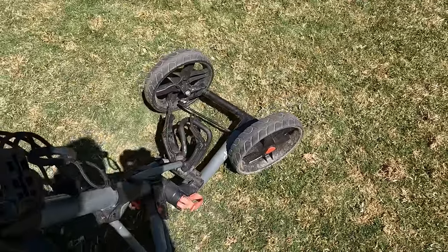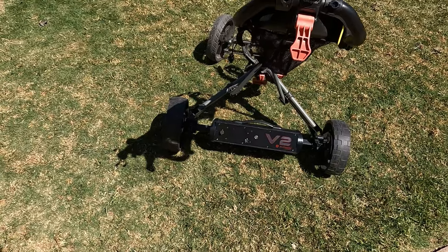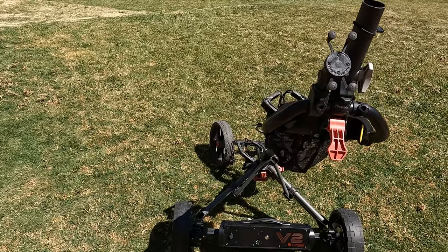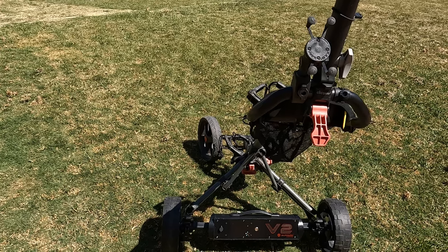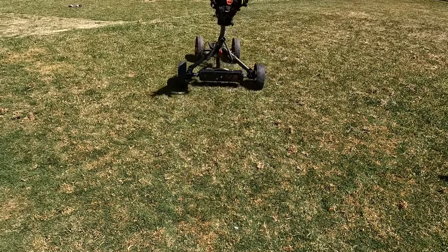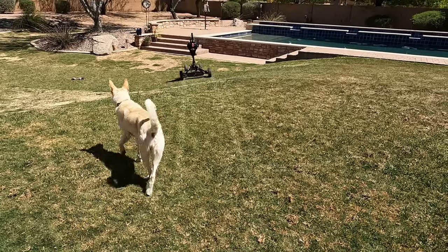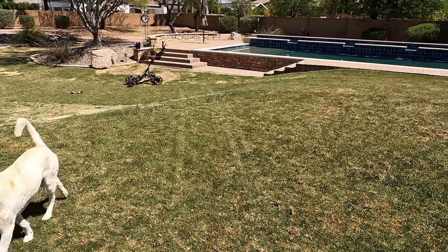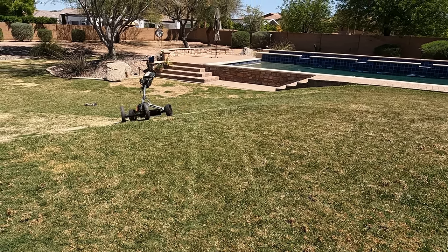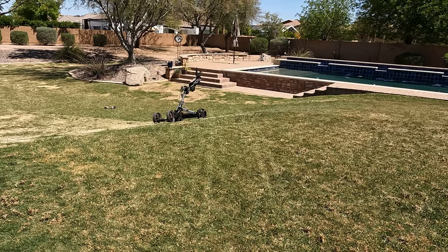You can see this has a steering wheel versus dragging the front wheel around. Here's a real good test — there's a little incline up ahead. The old one without the gyro would just fall and go down the hill coming over an incline. Going straight — you can already tell the motor is a lot more torquey. Turn it around, come up at an angle — look at that, it holds! There's the torque — it twisted in the mount, so I'll need to tighten those mounts.